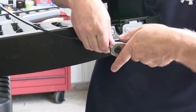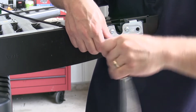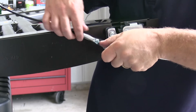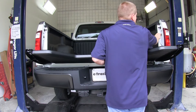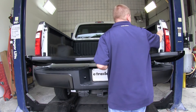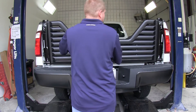A quick tech tip: the cables are only intended to support the weight of the tailgate and small items such as coolers, small toolboxes, or light lumber. They are not intended to support the weight of a person. Now with both cables on, we can go ahead and test fit it and see if it closes properly and latches. If it does not, you may need to make some minor adjustments to the latching mechanism to line everything up properly.